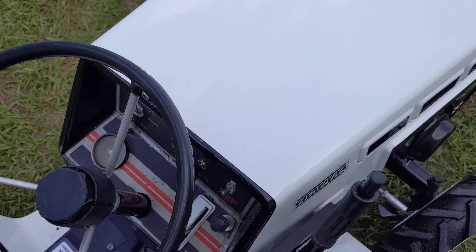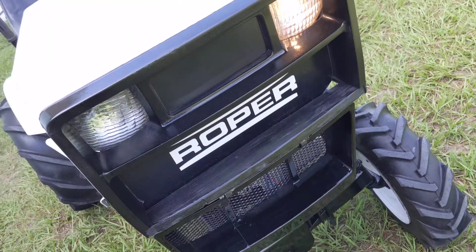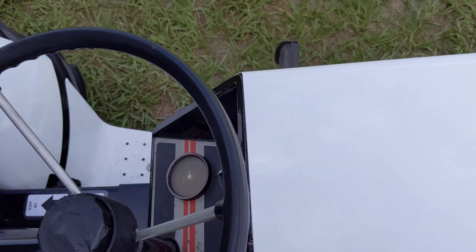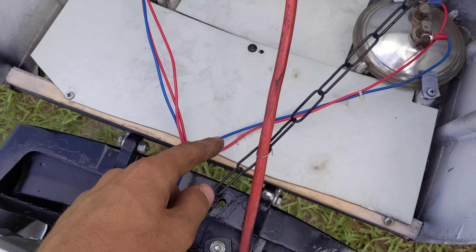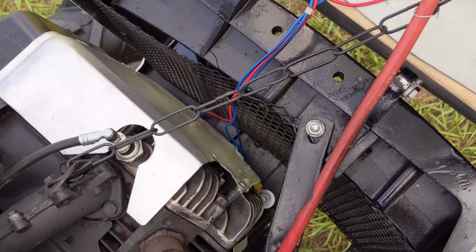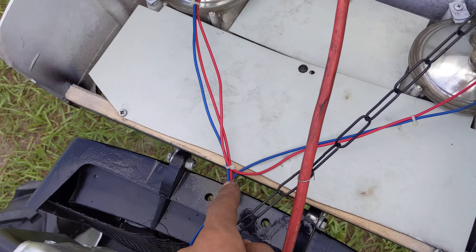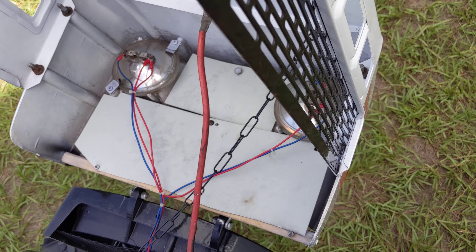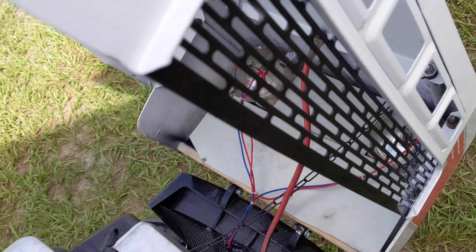With the lights — they were working. As you can see the rear one works. But look at that — one headlight again. So apparently the way I wire these, those headlights don't like it. Let me try to get this hood open and see if I'm doing something wrong with the headlights. The blue wire is the ground wire — it just goes down to the frame. The red wire comes in, splits off, and goes to the other headlight. I'm not sure why it keeps blowing, and it's only this one that blows on every single tractor — I don't get it.